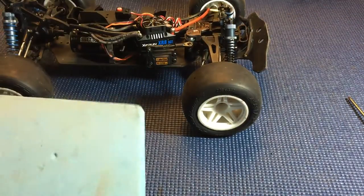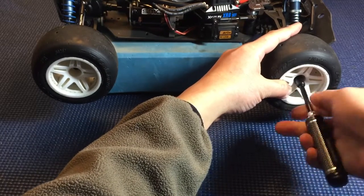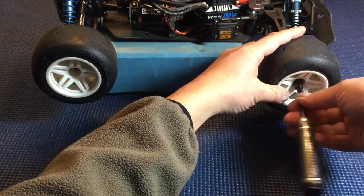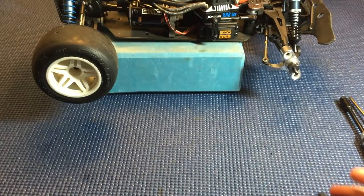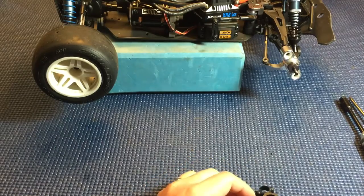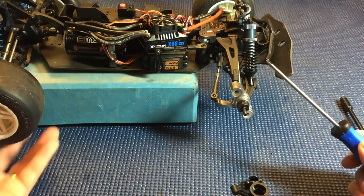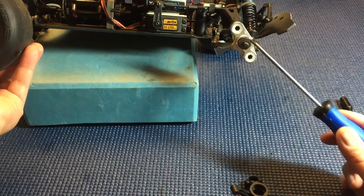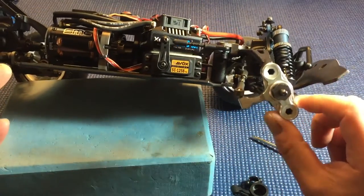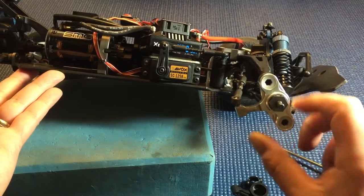Let's go through that a little bit — we've got to pop the wheel off here to look a bit more. Let me get my little fancy Schumacher wheel wrench here. So it seems there are a few different things, and if you have thoughts on this I'd love to hear them because it's still a little bit of a mystery. But the first one is really these N2G steering knuckles. I like these because they're aluminum and really sturdy — I haven't had any issues with them. They actually have these nylon inserts, and what I found is that these nylon inserts have to be set pretty darn loose.